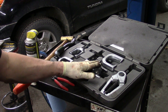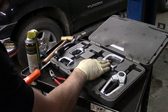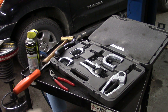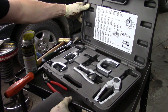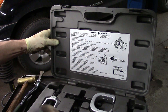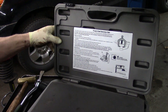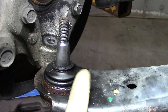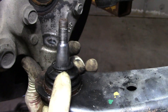So anyhow, that was the main bit of kit I wanted to show you. That one and this one here are my most frequently used. I have some other pitman arm pullers that I use more — actually I've never used this one because I like my other ones better, but it does come with a few other kibbles and bits. I also use that one for pulling bearing races off of front wheel bearings. The goal of using that tool is so you don't split the boot, whereas if you used a pickle fork or some other methods, you take the chance of breaking the boot.